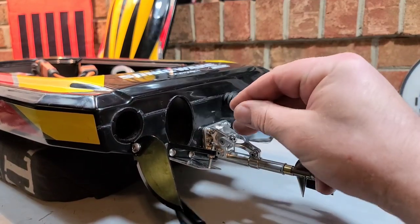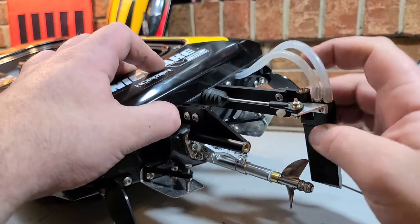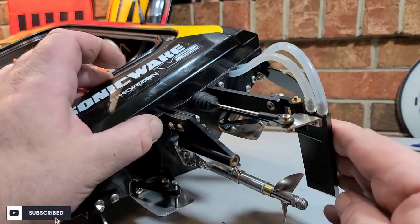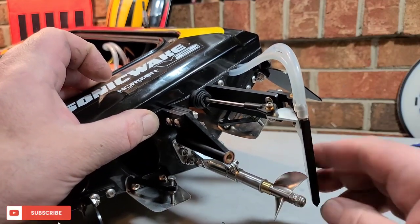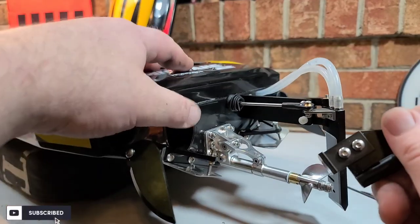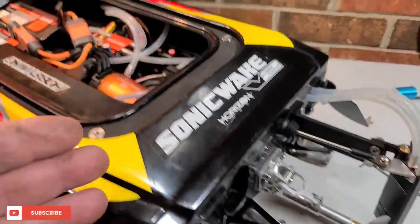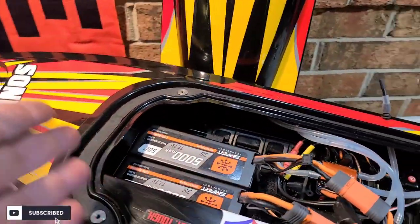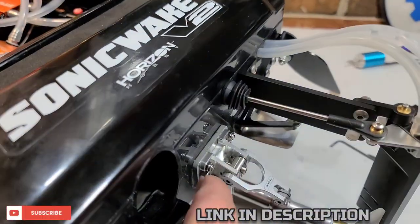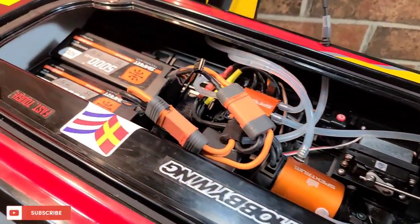The new stinger is a little bit longer than the stock stinger, so we may need to put a small spacer between the rudder base and the rudder blade to move it out a little bit, because it's a little close - if it kicks up it might nick the blade. I appreciate you guys watching. Like, comment, subscribe, and drop Mad Lizard a comment - he'll get you set up with the Mad Stinger upgrade. We'll see you guys next time. Big B here with Ironclad RC.